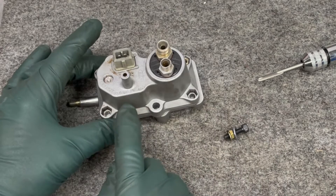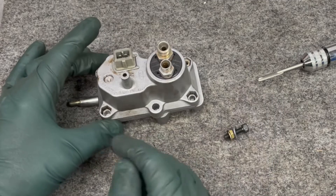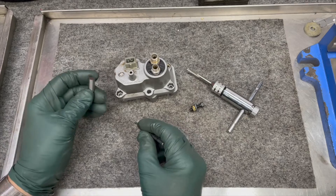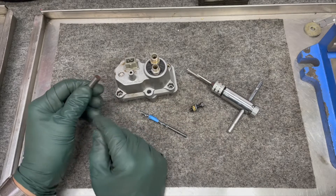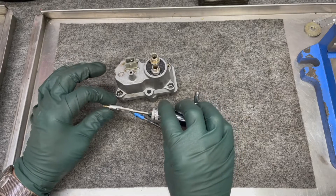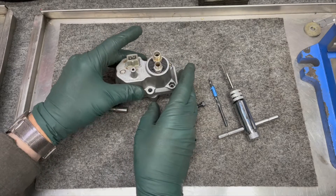I won't be able to use that little roll pin — we had a heck of a time making the final adjustments because there's a vacuum leak created by the roll pin. I have another option I'm working on, and I am going to do a kit. It'll include the proper size drill. This is really critical: this is very soft metal, so if you don't use a quality tap or the correct size drill you can ruin it. You have to use a high quality drill, a really good tap, go in straight, and don't go too deep.